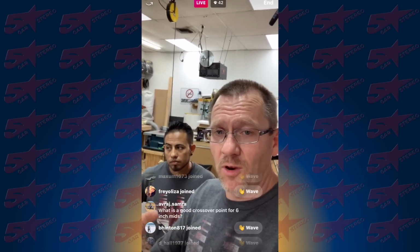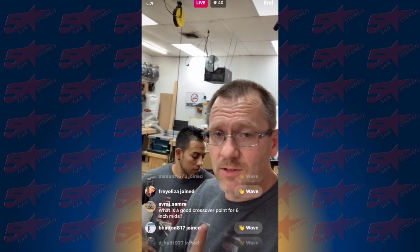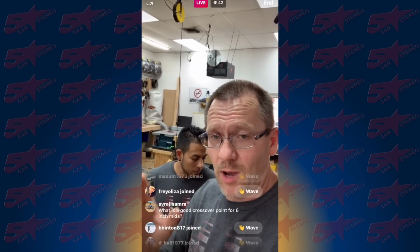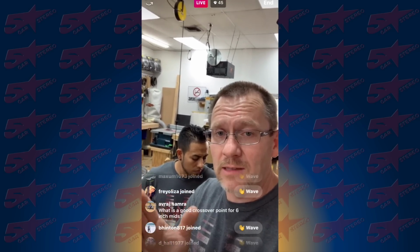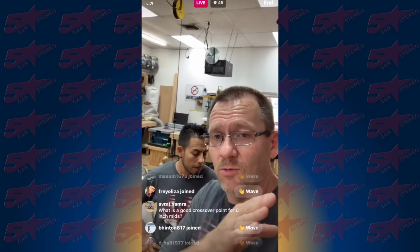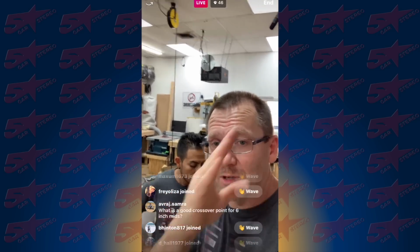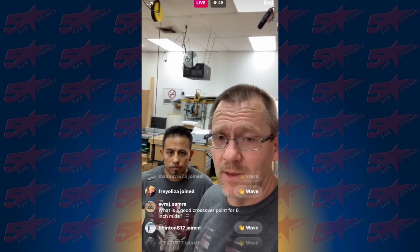You may find yourself going up or down depending on the type of music you listen to. Play it without the subwoofer, though, with the type of music you're listening to. That way you can hear if it's too high or too low, and then you can experiment from there. By going from 12, 18, 24, you'll also block out some of that lower frequency because it'll drop off a lot faster, so you can get more mid bass out of it and have that lower crossover point.